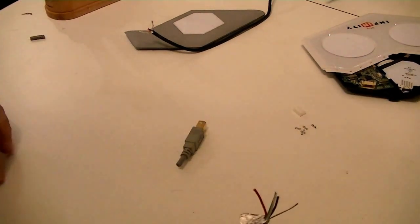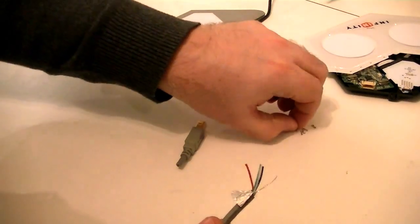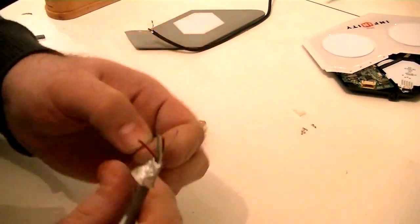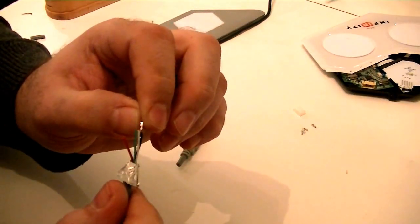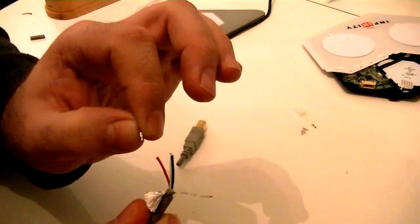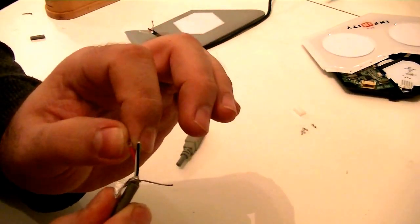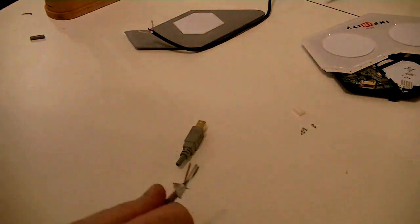So now what we're going to do is we're going to take just a little bit off of each edge. We're going to pop them through here, thusly. Well, this guy we're going to deal with last, because he's got some extra stuff that needs to go. We're going to pop it through there, drop a little bit of solder on, boom.